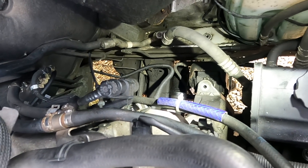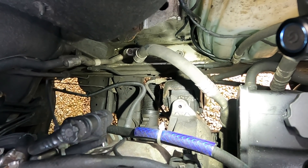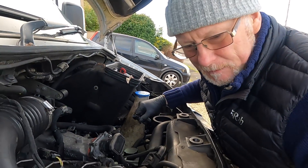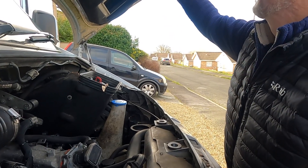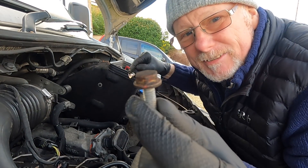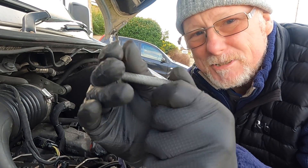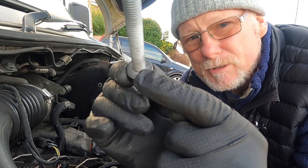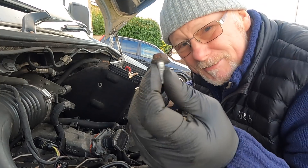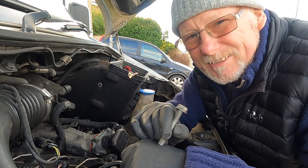There's that one down there, nice and clean, and so is that one. This one is actually the engine mount, although looking at it, it does look a little bit pitted still where the cable was sitting — you can see the pits in the aluminium. The 13mm bolt goes into the chassis rail of the van, and underneath here it looks really clean and almost brand new, whereas the engine mount bolt was a little bit manky. I wire-brushed all underneath here as well. I think this may have been the culprit, because the chassis end was making good contact whereas the engine mount end is a little bit doubtful. I'm glad I took this apart — at least it eliminates this possibility.